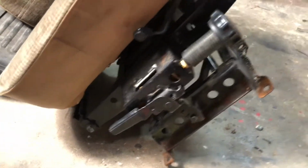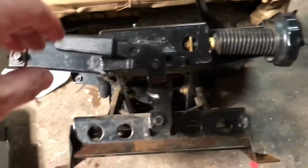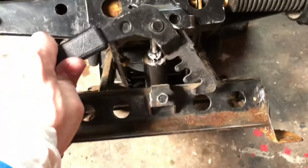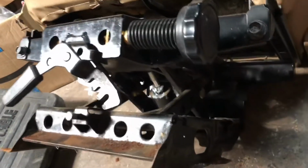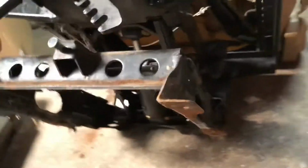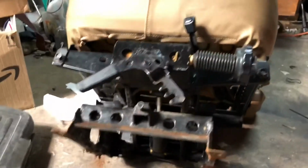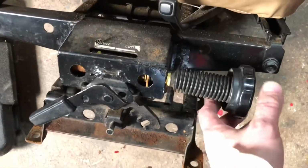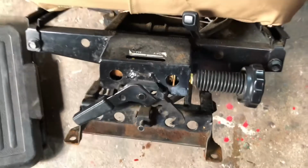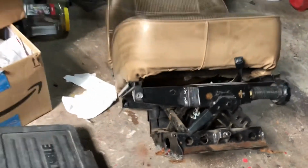And then when you want to go off-road, you just unhook it, and the whole seat bounces on a shock absorber underneath the seat. And you can adjust the firmness of the shock absorber by this crank right here. Kind of a cool feature for these little off-road vehicles.